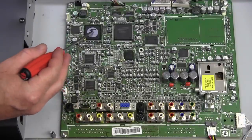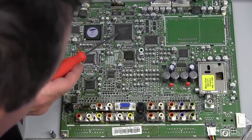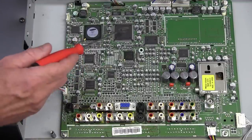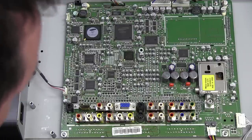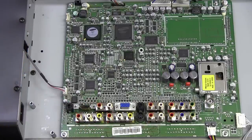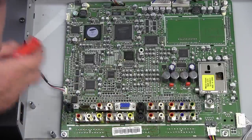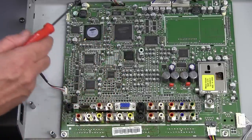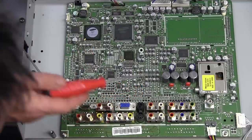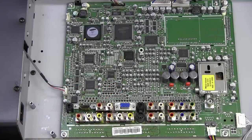Alright, we have a Samsung BGA chipset here labelled STP22, and another Samsung DNI-E — that's the processor. That's their, I think, one of their whiz-bang display technology custom algorithm chipset type things. We've got our tuner over here. We've got all our inputs mounted on the one board — I sort of didn't expect to see that; I sort of expected maybe a separate board for all that. But there's a lot of electrolytics on here. Look at all these surface mount electrolytics — there's an absolute ton of them. And these are rather unusual looking.